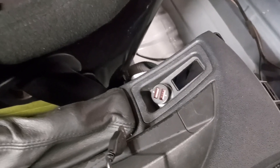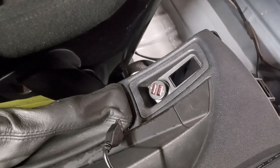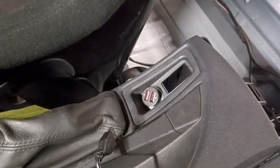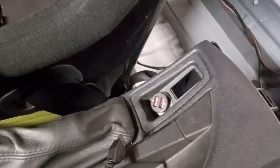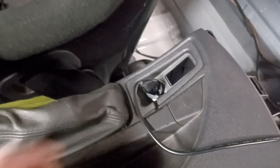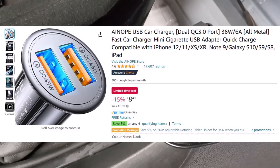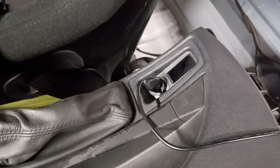What I have here is one of those lighter-to-USB adapters. They're not all equal — I bought a really cheap one to start with and found it wouldn't deliver enough current to keep up with the camera, so the camera would run out of charge before the end of the race. We race for 90 minutes. This one I've got is a 3-amp adapter; the camera takes about 1.5 amps. I've not had a problem with it ever since I put this adapter in.